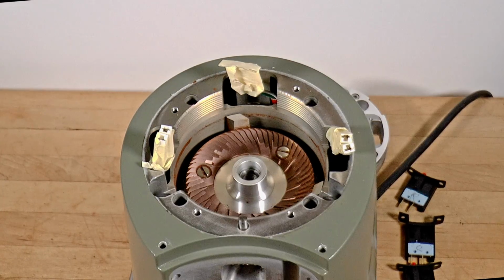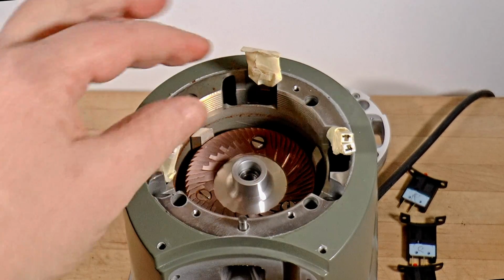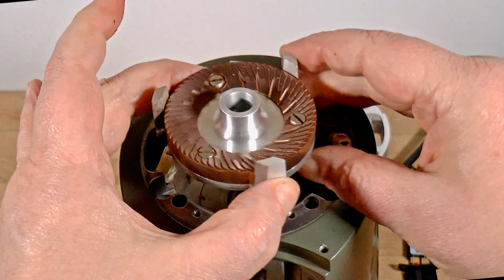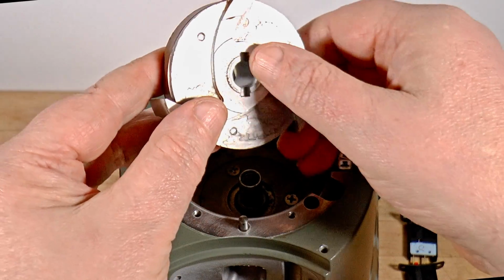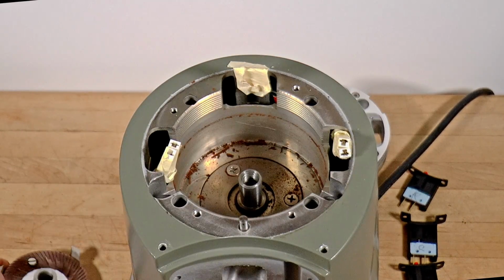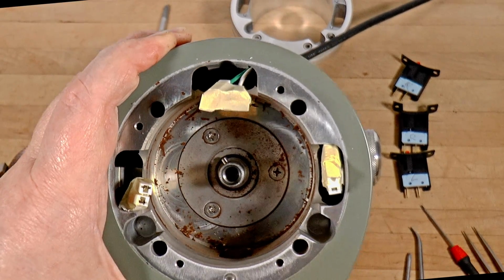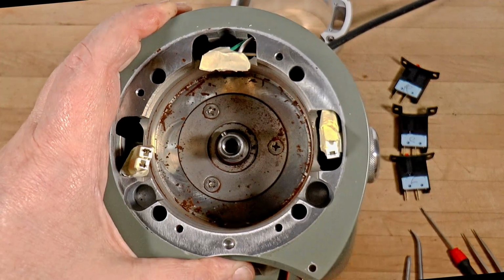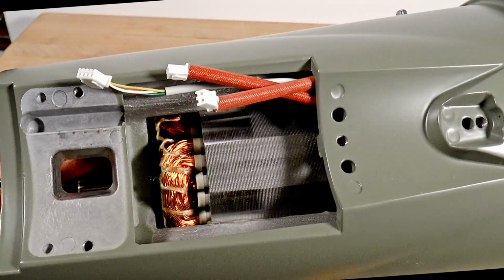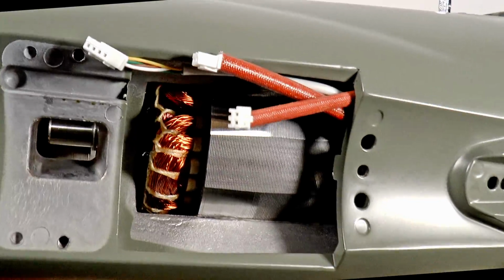And now the lower carrier. The underside of which is remarkably clean. The grind chamber design is excellent, especially the wedge shape of the wipers and how precisely they're fitted. There's a crescent spring washer under the spacer which resists loosening from vibration. We've got a nice stout bearing here for the shaft, and an obviously industrial duty motor, and sleeved wiring.